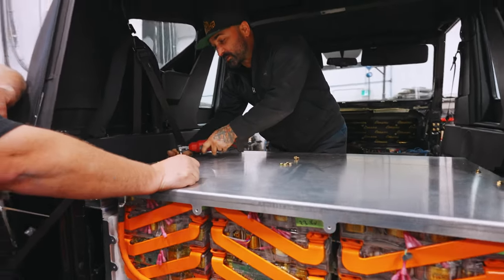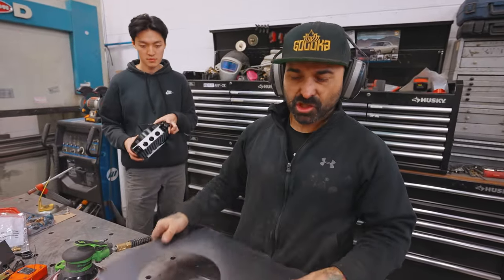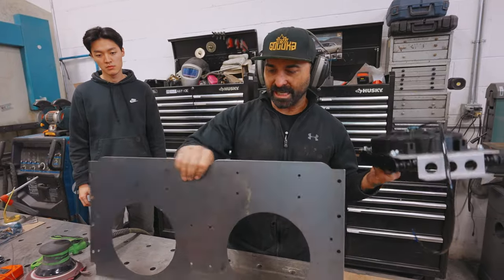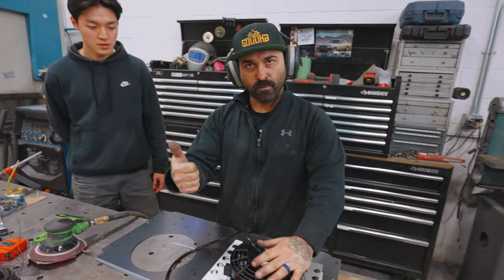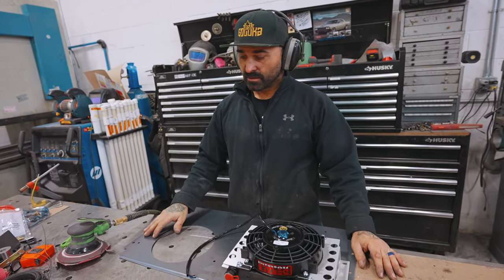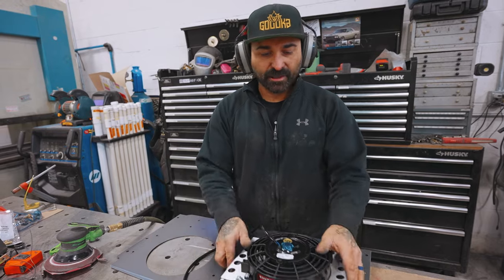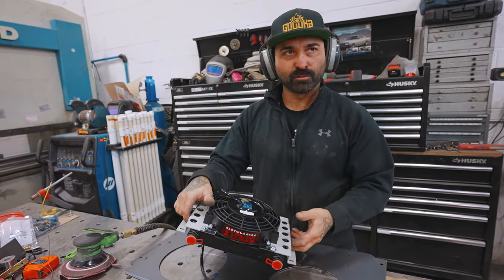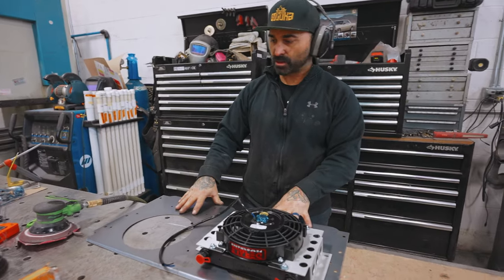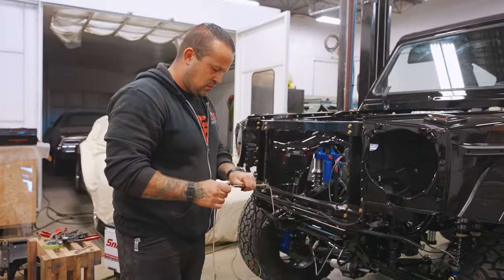My eyes are burning. I feel like I'm shooting fire out of them right now, I'm so tired. This is the dual heat exchanger system that is going to be used in the G-Volt. Alex came up with this idea — a single plate mount for two heat exchangers. One's for the electric motor and one's for the battery pack. They need to have separate cooling systems so they stay in their optimum operating range, which requires significantly less cooling compared to a combustion engine. Two heat exchangers, fans, and the reservoir tanks will get mounted onto this, and it goes in the standard location behind the front grill.